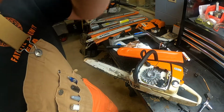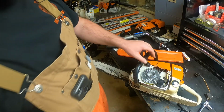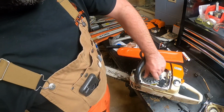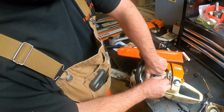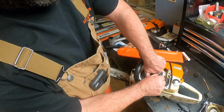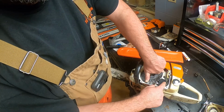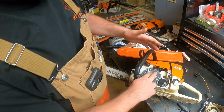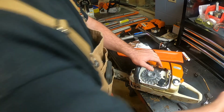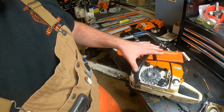This is the new flywheel right here, and we used our gauge to verify our distance right here. So we're good there. There we go. That is just where you want it. Again, we put it down in there, push it up tight, snug it down. We're good to go. Now, before we adjusted that finally, again, there's video earlier of just changing the module.